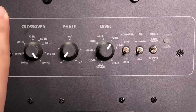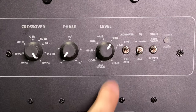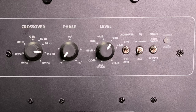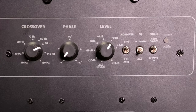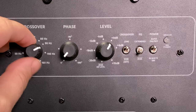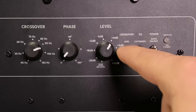For most people, just leave the crossover off and let LFE take effect. But if you have an older setup without an LFE-type setting, turn it on and set it to what you need. Traditionally, I'd say put it 20 Hz above where your speakers are crossed over — so if your front speakers cross over at 80 Hz, try to get as close to 100 Hz as possible. But most people won't need to use this.